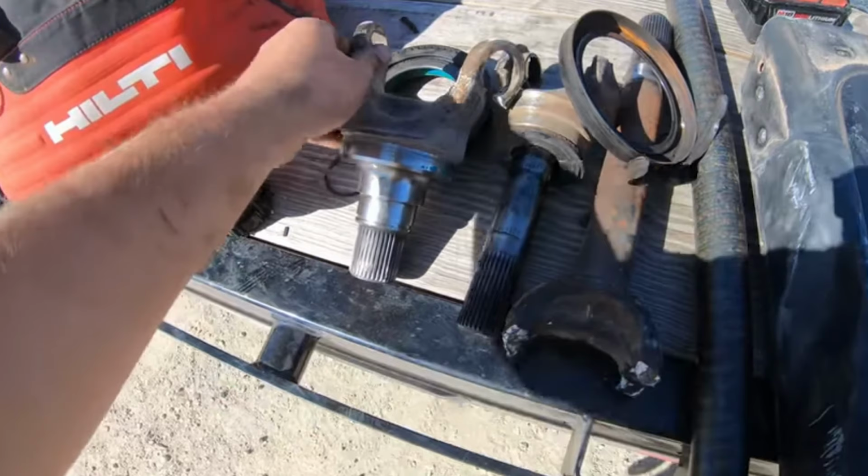I have seen this in person multiple times now, and actually when I was on trail to SEMA, we had a whole bunch of people with Dana 44s that were on 40s. None of them broke. We had two people that were on Dana 60s on 40s, and they broke axle shafts because they were stock axle shafts. It's definitely not uncommon.